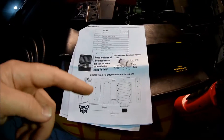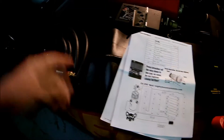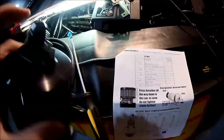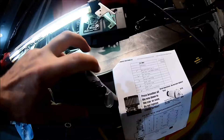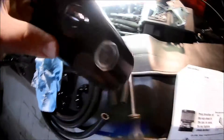We don't want the engine to eat itself. We want to capture that oil and be able to scavenge it for later. This particular one — most have a breather, but this one does not. I ordered it with the recirculator. There's a little check valve in the top. When the pressure builds, it's going to come in this line and recirculate back to the engine in this line, then drop its oil down in here, where you can see some metal bits to filter it out a little bit.